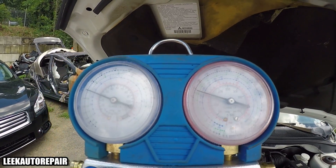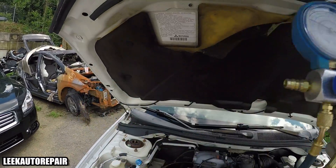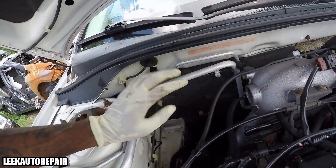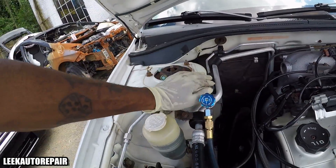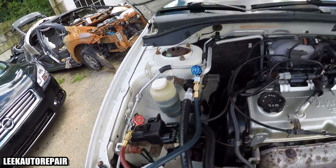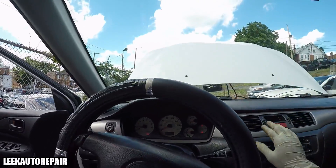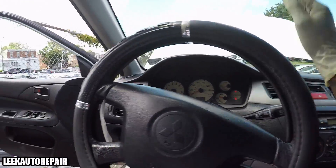Right now I'm at 150 or a little bit over, and the low side balanced out to a little bit under 30 — either way I'm in range. You also want to make sure your line is cold — this line is cold and sweating. Look underneath your car to see if you're dripping water; when it's dripping water your evaporator is getting cold. Your hot side line should be warm, not hot. Check inside your car — the air is cold and nice. Got the recirculation door closed, that gives you maximum AC.